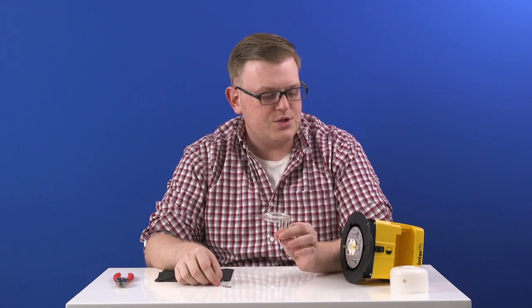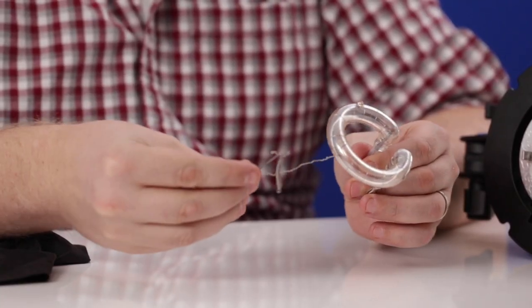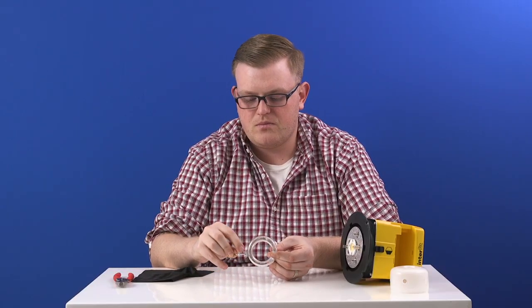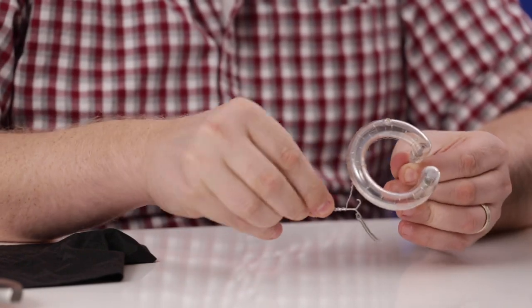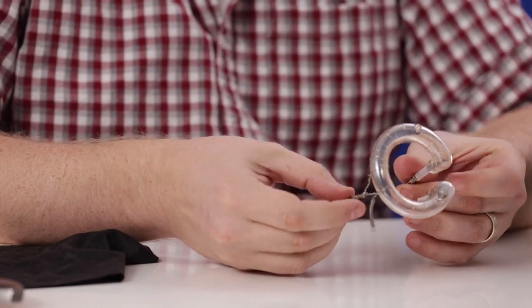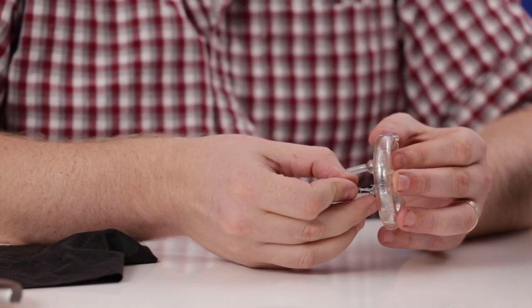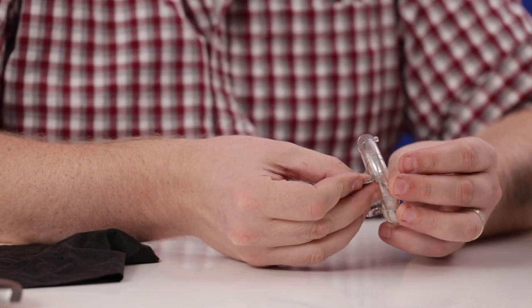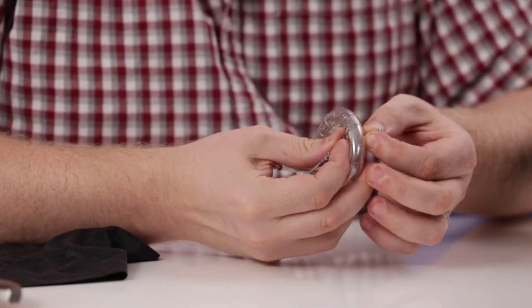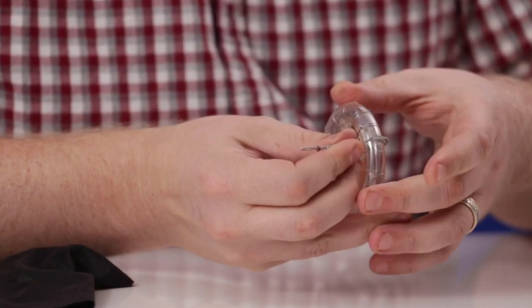With your new flash tube, you're basically just reversing the process. You're going to start by wrapping this wire around the stabilizer prong — just get it here and wrap it around a couple of times. You'll leave yourself a little bit of slack so you can get the spring situated. Once you have this wrapped around, you're going to put the flash tube into this groove right here, and then either using your fingers if you're wearing gloves, or your needle nose pliers, you just reattach the spring.